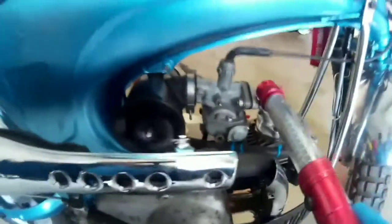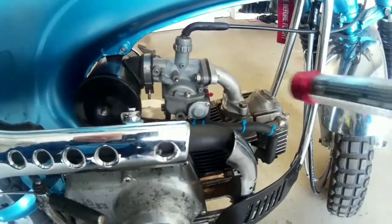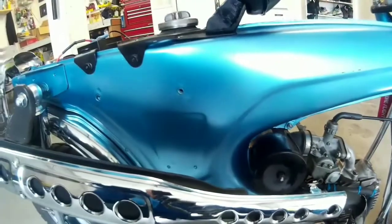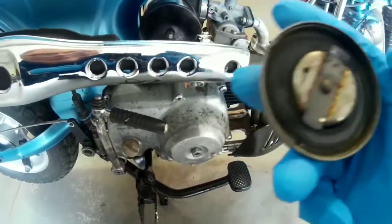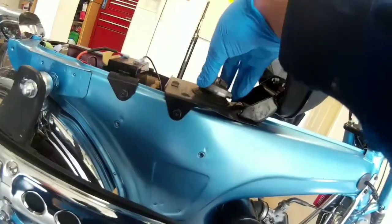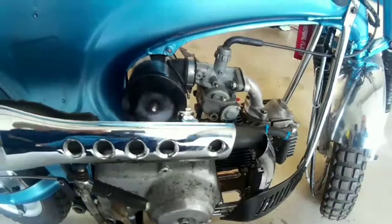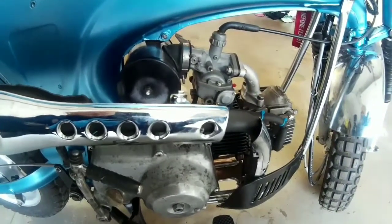So this is what I've done: took the carburetor apart, blew out all the jets, and adjusted the flow so there's more gas in the bowl. I also drilled out this vent section right here a little bit bigger and put my air gun to it to make sure there was nothing inside. I think that might have solved the flow rate issue, because I'm not noticing a difference in flow from the gas tank into my jerry can whether the cap is on or not.